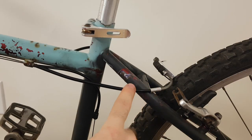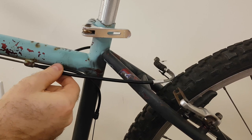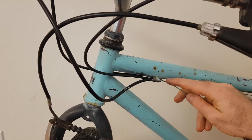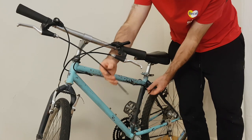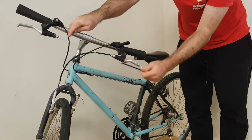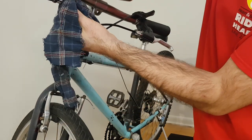From the noodle, if you follow the piece of cable housing that's next to it, you'll find that it meets a point on the frame here — these are called cable stops. The slack created by disengaging the brakes should allow you to take this piece of cable housing and pull it out of that cable stop and let the cable fall down. Closer towards the front of the bike, this piece of cable goes through another cable stop, and you should now be able to pull this other piece of cable housing out of that cable stop as well. So now with this rear brake cable completely disengaged from the cable stops, I'm able to take this long piece of cable housing up at the front and slide it all the way to the back, which will expose this long section of cable which was otherwise covered up before.